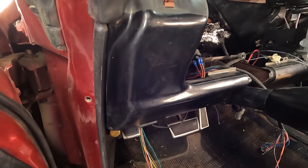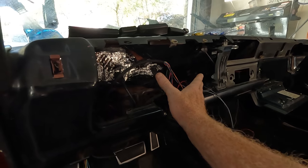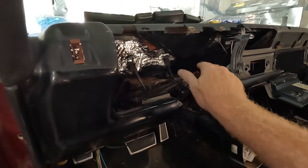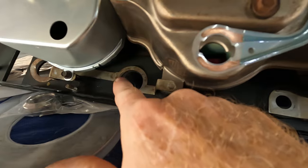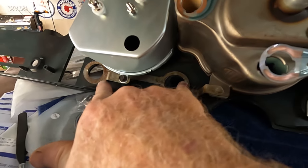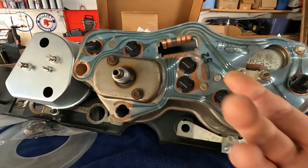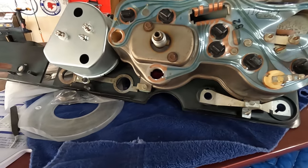I'm not going to put in the dash all the way, because if I've done something wrong or need to get access, it's going to be crazy to try to get it off. The only concern is I won't be able to test it without grounding it. The dash goes in and grounds right here at these two sections. The back of the dash is all connected, so everything all the way across is grounded out. So these bolts are my grounds, but if I can't put the dash all the way back up, it's not going to be grounded. I may have to hook up a ground wire to the dash just so I can test it.